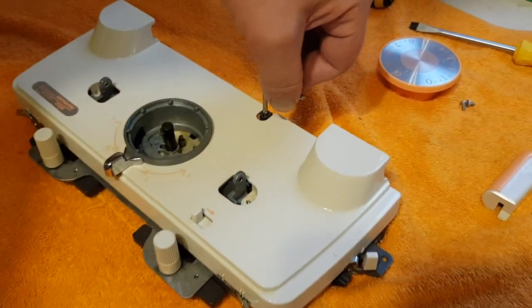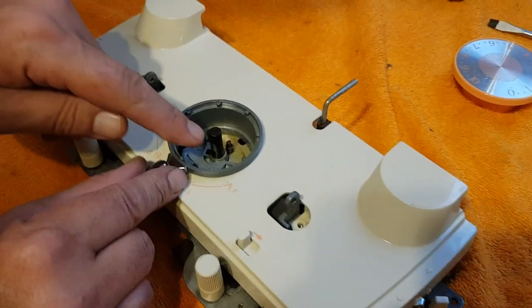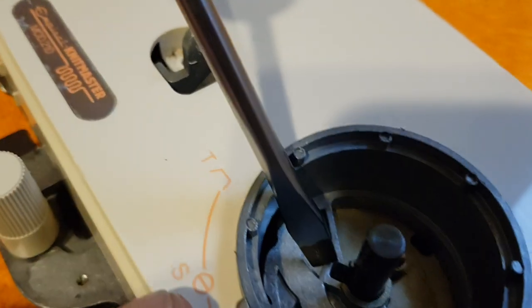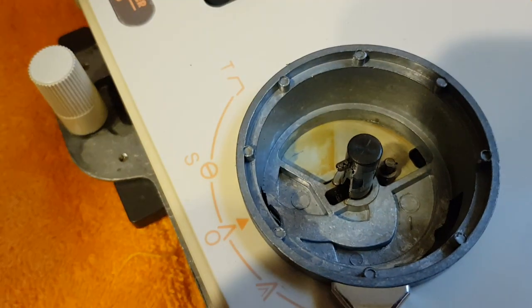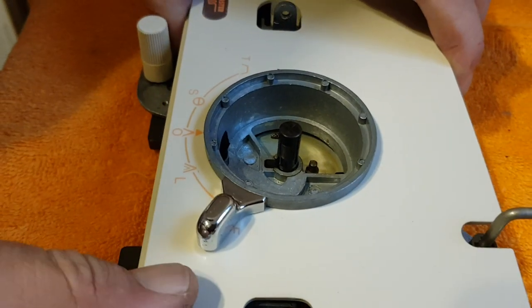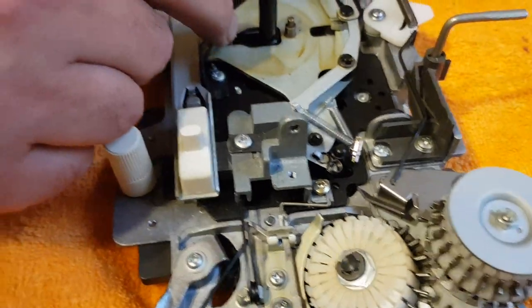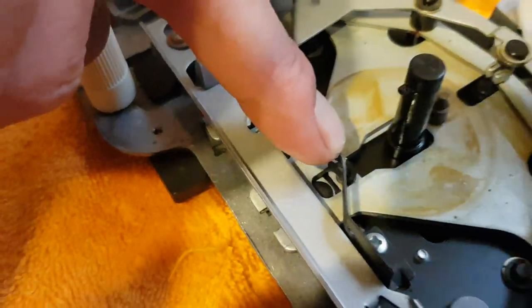Next step: see the tripper here — turn that out. You can see a little pin right here, and there's a slot down in here. That pin and that slot need to line up. Spin this around so we've got a nice straight line for the whole angle slot. There's a little spring here that pokes through — push it in with your finger to release the carriage casing.